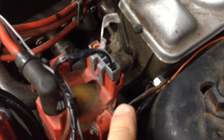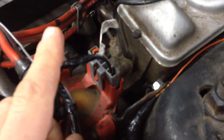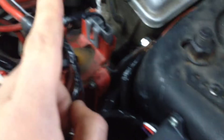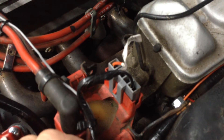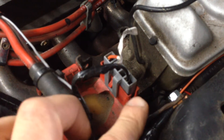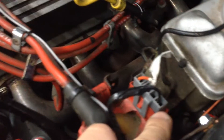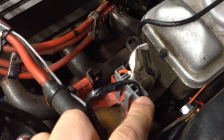So what we did was, from the original harness going back into the car, we snipped the wires. We tested the one purple wire that comes off of the tach adapter on one side, and then reconnected the normal one to the other side. The first time we did it, it worked out — I'll assume it's the yellow-striped green wire. The regular power wire that comes off the tach adapter, you reconnect it together with the red side wire on the original connector.